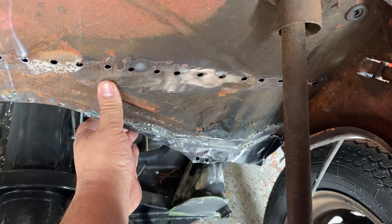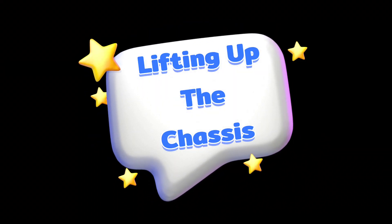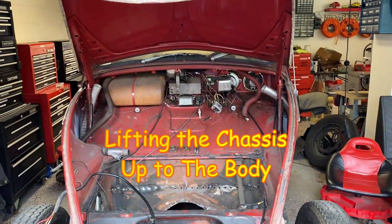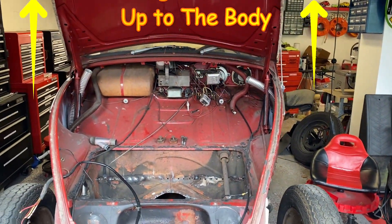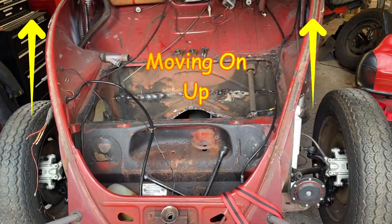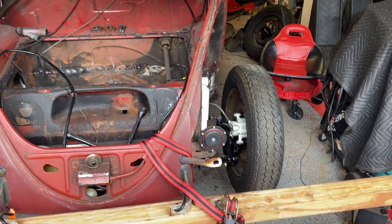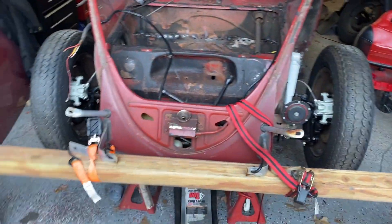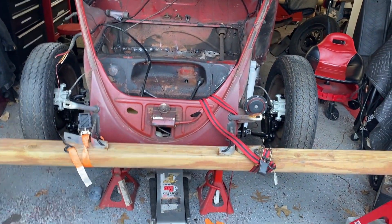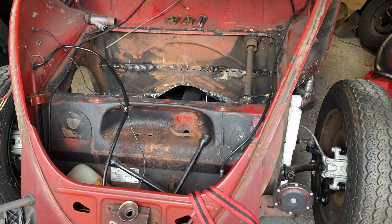This firewall is still not totally attached — it's still flimsy. I'll put some wood underneath here and start lifting up. Let's see where we're at — probably a little off, but we're not there yet. Let's keep going. Now you can see the body's starting to move, so I'm going to bring it down. I'm going to have to move the chassis left to right using the jack — left to right — just to clear out some stuff. This is kind of dangerous to do one-handed, so let me set you down and then I'll show you what I'm going to do next.